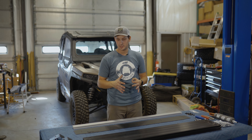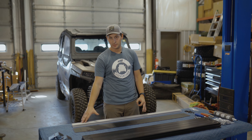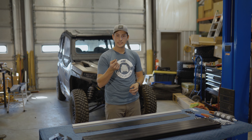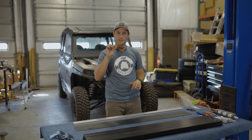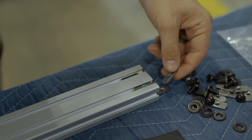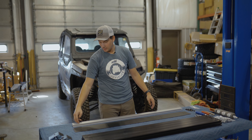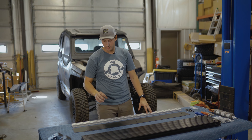Now that we know we have all of our parts, we're going to go ahead and assemble our wind deflector. We're going to do that by grabbing our silver crossbar and laying it down next to the wind deflector. Then we're going to grab our T-nuts — we're going to need 10 of them. Make sure the flush side of the T-nut is facing up, and slide them into the top of the crossbar. Space them evenly and line them up with the wind deflector so you can find all of those nuts when you put the wind deflector on top.